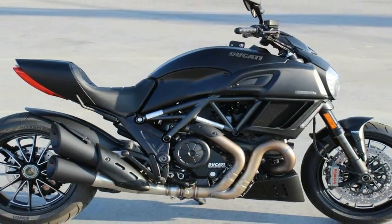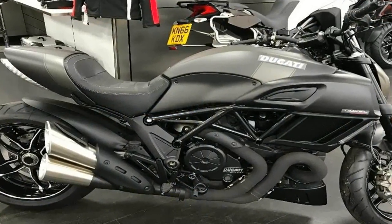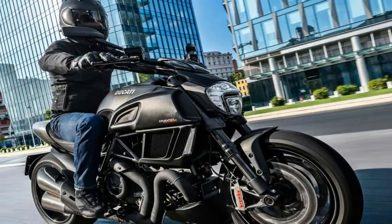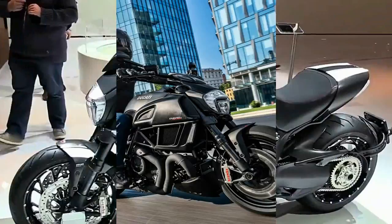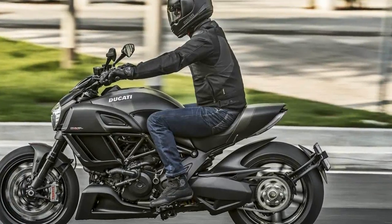Ducati built the bones of the devil using a combination of die-cast sections and thin wall tubing, all in lightweight aluminum. The factory uses what they call a technopolymer member to bring the two main sections of the frame together and form the abbreviated subframe assembly. This leaves us with a stiff frame capable of handling the great torsional stresses generated by aggressive maneuvers without chunking out above its 527 pound fight weight.